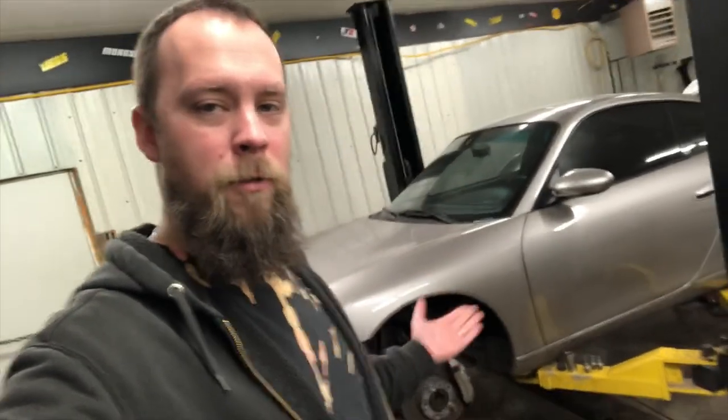Hello everybody and welcome back to Funahead TV. Thank you so much for watching. Behind me is my beautiful 2001 Porsche Carrera 4 that we are currently working on several spring projects on. The big one we're going to continue working on today involves the transmission. We are taking out several gear sets to eventually get to the second gear synchro and second gear itself, to remedy the symptom of grinding while going into gear and the occasional second gear pop-out right after going into second gear. This is a very common issue with these transmissions as they start to age, specifically with second gear. We're going to continue fixing that today and pick up where we left off in the last video, where we took off the nose cone and got access to everything within the transmission, and now we start tearing it down.